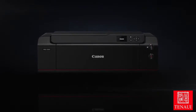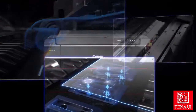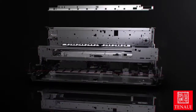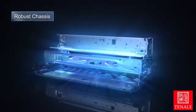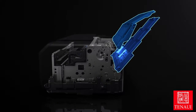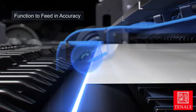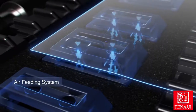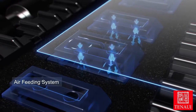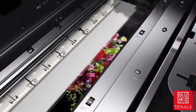Other technologies have been built in to enable effortless printing of high quality images. The robust chassis reduces vibrations, which improves the accuracy of ink droplet placement. A skew correction function guarantees that all types of paper, including thick paper, can be printed without misalignment. The air feeding system keeps the paper flat during printing, which helps ensure accurate placement of ink droplets on the paper. Also, the non-firing detection and compensation function makes sure that every print is consistent.